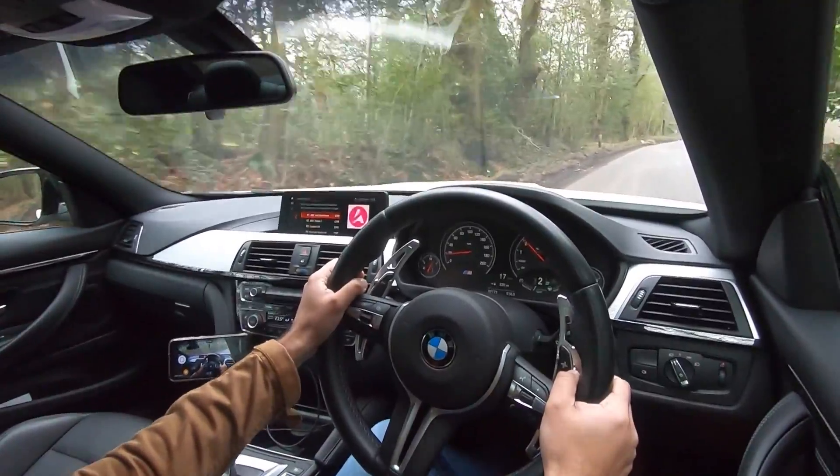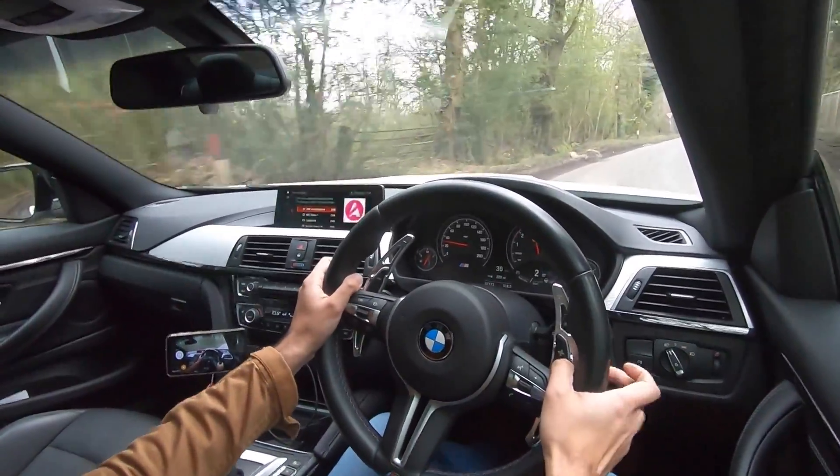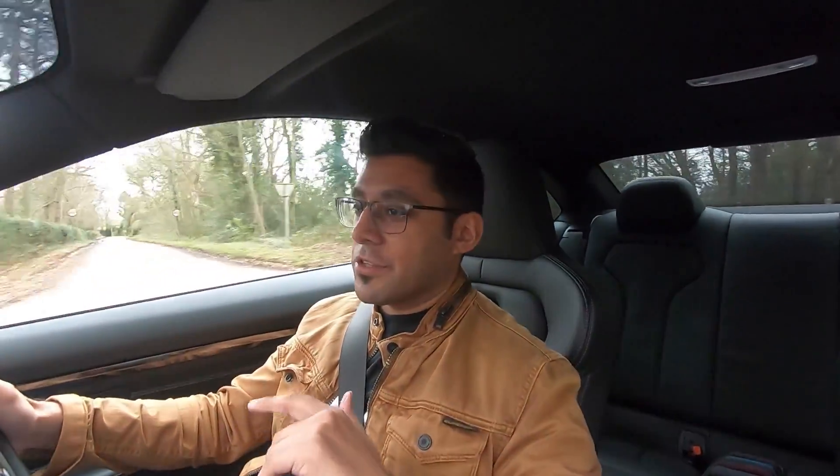Whoa, keep on your side, mate! Anyway, another thing BMW's M technician said is: don't go by the computer-based servicing intervals that show a service due at 15,000 miles. Common sense prevails - it's a high performance M car. You should get the engine oil and filters changed every six to seven thousand miles, that way you're guaranteeing you're running on fresh oil and maintaining good engine health throughout its lifetime.